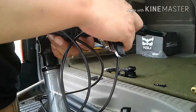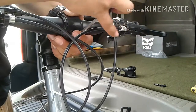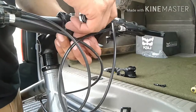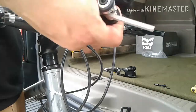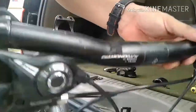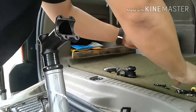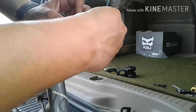You could damage your cables, your brakes, or even your handlebars. So be very careful when you're on the last bolt and remember your handlebars can fall and you can get some serious damage done. So we've got this plate off — put this aside, and you can just go ahead and rest your handlebars down on your front tire somewhere. And put this plate back on for safe keeping of the hardware.